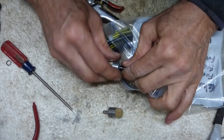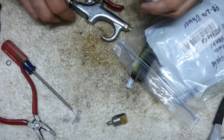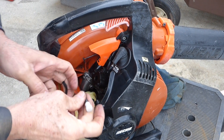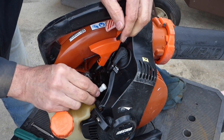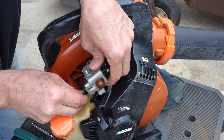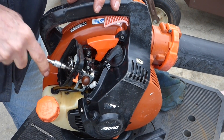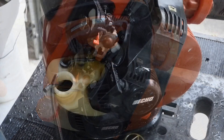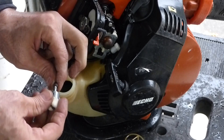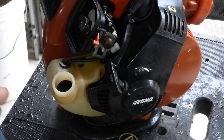Now of course it's best to go ahead and change it — I've got a new one here. But that'll get you by in a pinch. We'll slide this back in the tank. This is pushing fuel, this is pulling fuel. So we'll hook this up, and we'll go ahead and throw the new filter on and drop that in the tank. Beautiful.